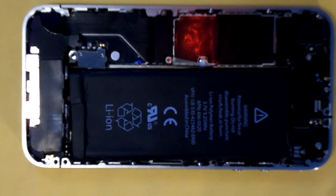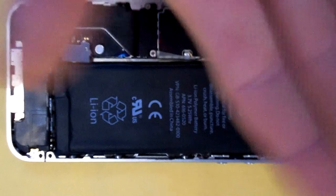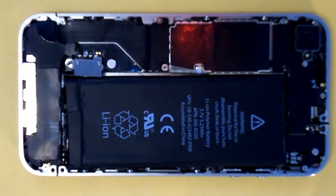So let's start off. We've already got it going a little bit. You're going to want to remove the two bottom screws with your pentalobe or your Phillips head screwdriver, and then slide the back cover towards the top of the phone and the cover will slide right off like it were the back of a remote.